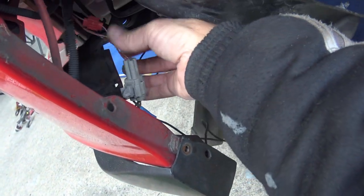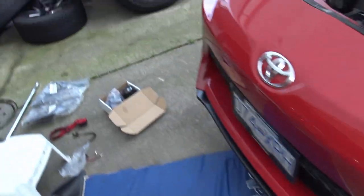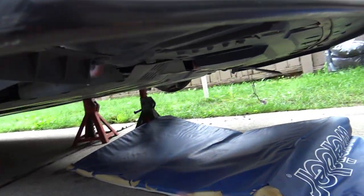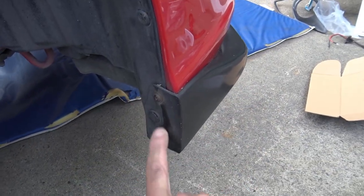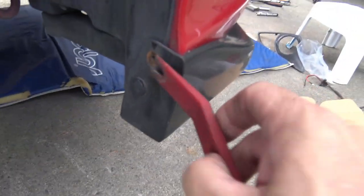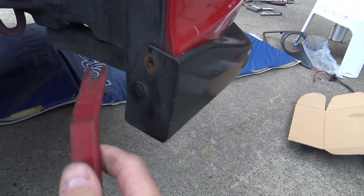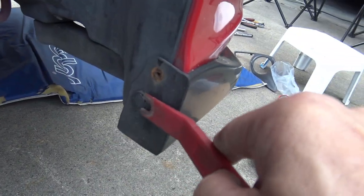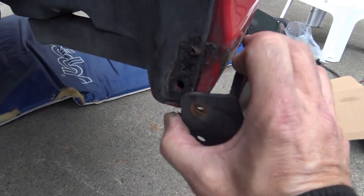Then you can get access to some wiring. If you're installing this for the first time, raise it up, take your front wheels off, and undo the clips. You'll also need to take off your belly pan. I've got my aftermarket front spoiler here and it'll have to be loosened — there's one Phillips head screw for that. These little plastic clips can sometimes be difficult to remove; having a little plastic pry tool, which you can buy on eBay, makes it a lot easier.